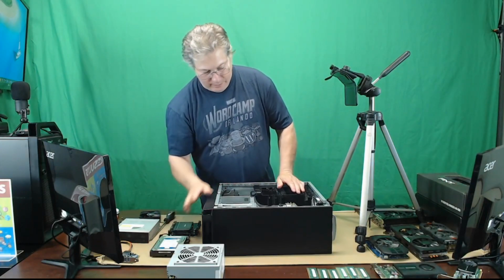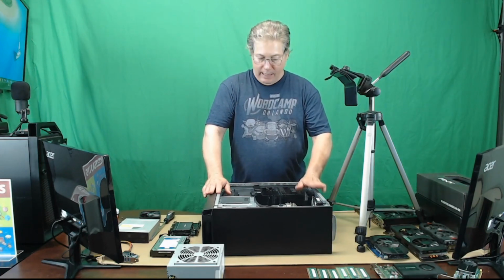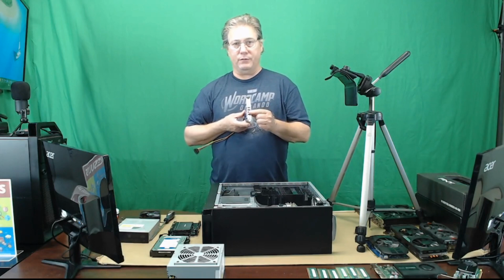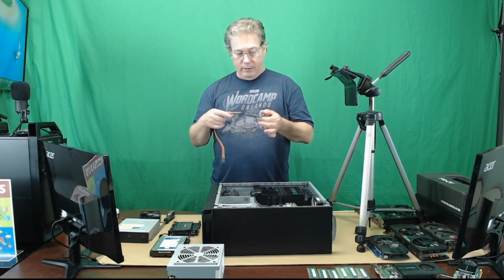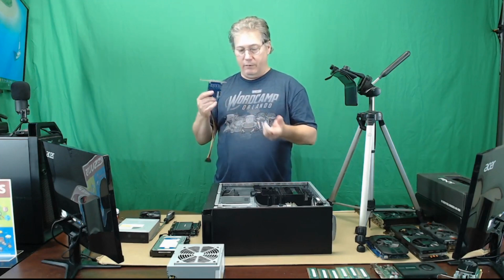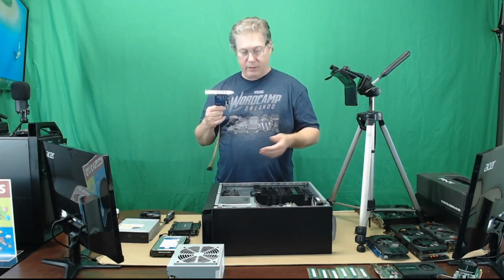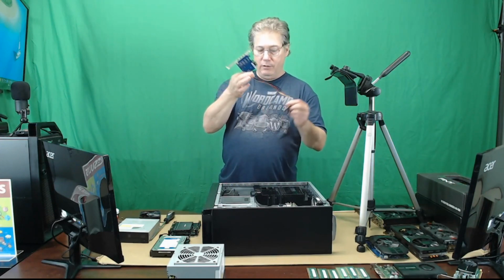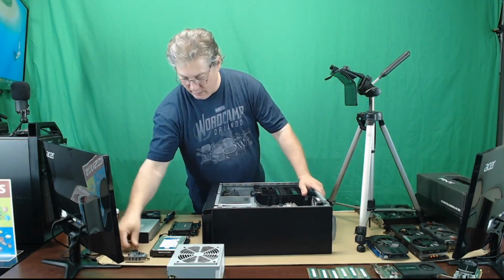They're ready to go. Now, these Lenovo S20s are good systems, but one of the only things that I don't like about them is they don't have any USB 3 support. So I had this card laying around. I was going to use it for a different build, ended up not doing it, and since I want whoever receives this to have USB 3 support in case they need it for maybe some external drives or whatever, we're just going to throw that in there. Got to get power, so we added an extension on here to attach to a SATA.